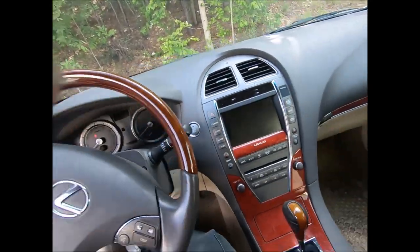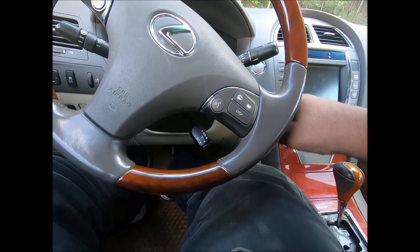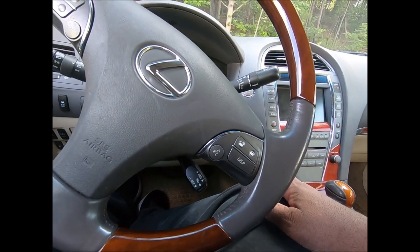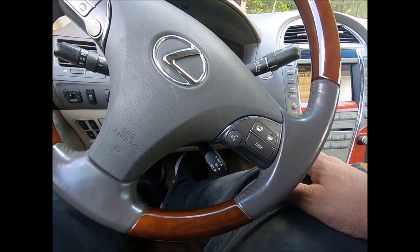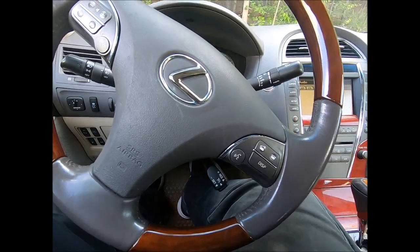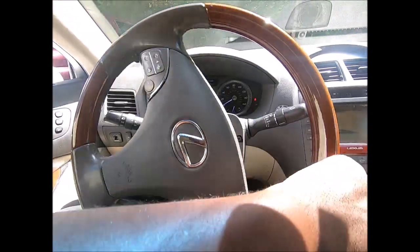When you put brakes on a car, the first time you step on the brakes, they're gonna go through the floor. Well, this didn't go all the way to the floor because they're on the back. If it's on the front, it's damn sure gonna go to the floor. So I'm getting ready to test drive to see, did I do anything wrong?